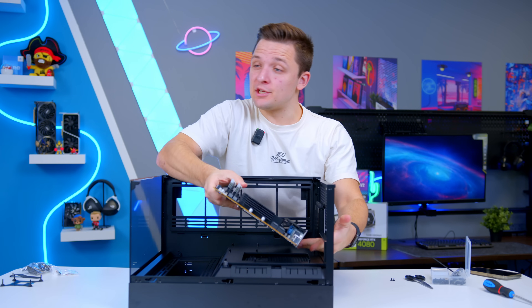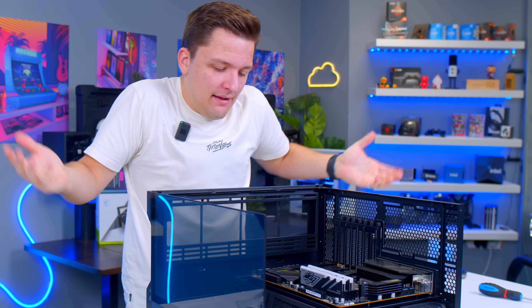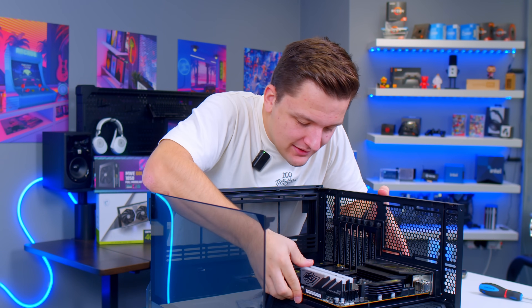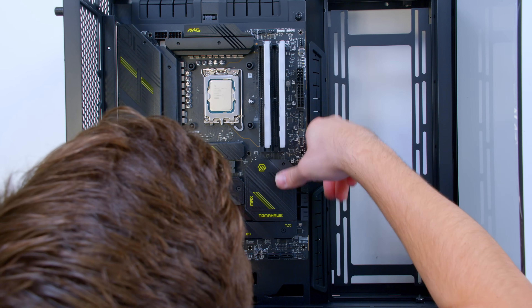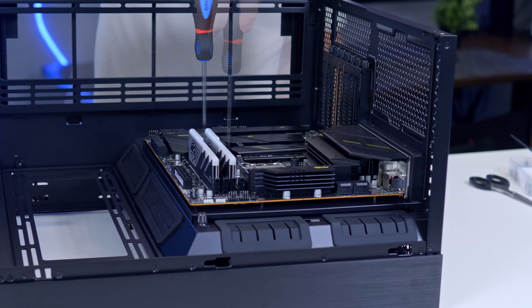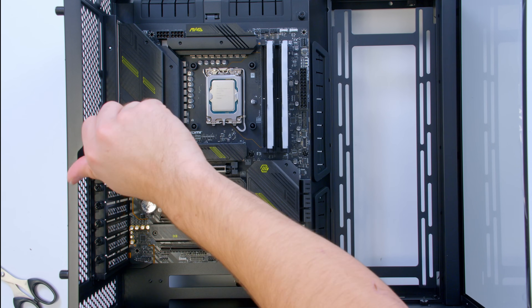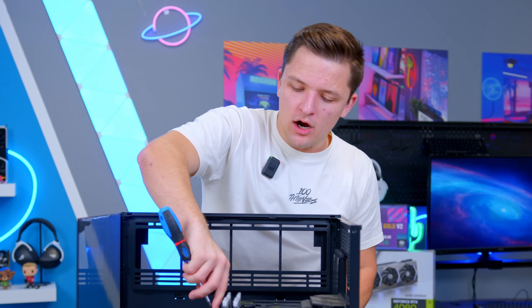I've taken off the top of the case, which actually makes seeing the motherboard installation a lot easier. It kind of looks weird, but I'm happy about it — it's a cool case to build in. Just get the motherboard standoffs nicely lined up. Bit of push required to encourage it into place, then it's a case of fastening all the standoffs — three across the top, three along the middle, and three down the bottom. As always, only support for an ATX board in this case. You are going to struggle with an E-ATX design; there would be a lot of overhang there, even though it would technically screw in without too many problems.